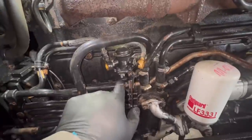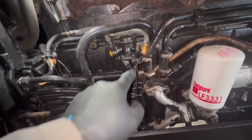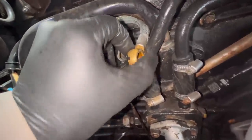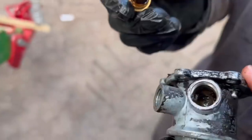This is driven by the crank or one of the push rods, so we'll take it off. There might be a gauze inside — sometimes they have a gauze inside them. Rob's going to blow down that pipe now and check there's no restriction in that. Yeah, that's all right. Rob's got the lift pump in bits and look at what the little filter's like.